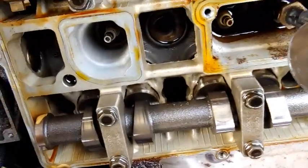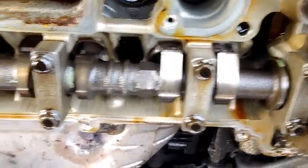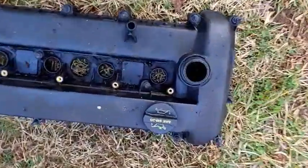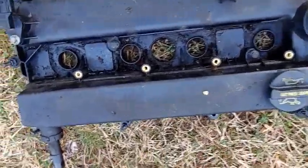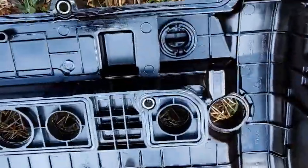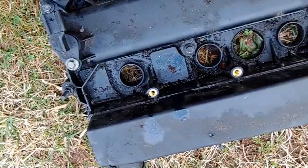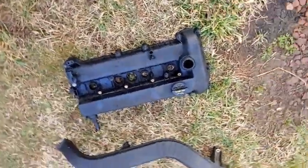There it is — it's off. The timing chain is good and tight, the cam lobes look really good, no discoloration. There's some oil down in there I've got to get out of the spark plug holes. There's the valve cover — I'm going to clean that up. There's a gasket there, and these gaskets here, and the one that goes all the way around. You can see where it's really flat — it's past its time. There's probably a gasket in there for that, and that's the oil filler cap. I'm going to clean this up and come back when it's clean to start putting the gaskets on.